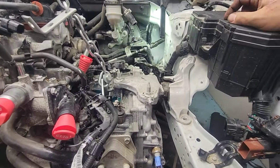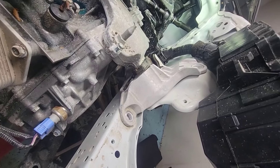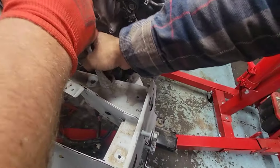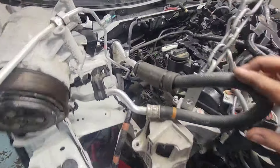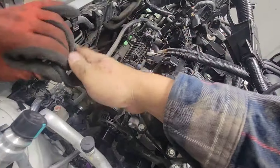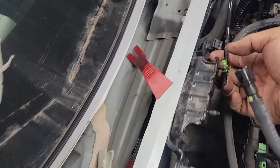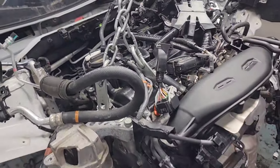Slowly jack up the hoist and let's see how this thing moves. Let's double-check — look under and behind, make sure there's nothing getting caught, any wires. This one — we'll take that one out. So I've got the fuel line disconnect here. This is the locking device, just pry that off and then press the green tabs on each corner, and then it'll pull out. All right, this is ready to come out.